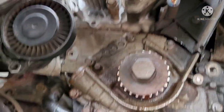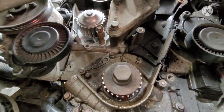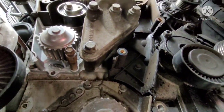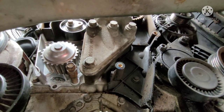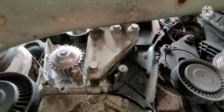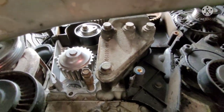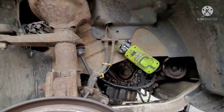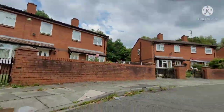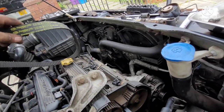All right, so we're out here now. We're at water pump installed, all tightened up, and now we've got the tensioner in as well. Just a little side note: when you're doing this, take your tensioner completely out before taking the water pump out. It makes it a lot easier to see the bolts. Put your water pump in, then put your belt tensioner back on. Just little tricks and tips if you're interested. Once you put that on there, the tensioner is on. It's not torqued up all the way.